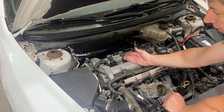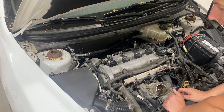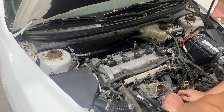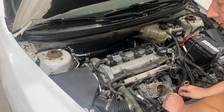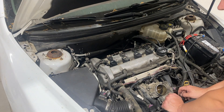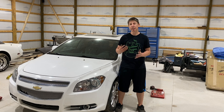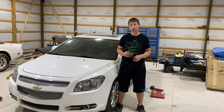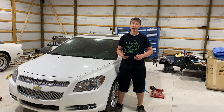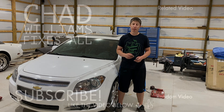After you're done, go ahead and clear the codes on the computer using your scan tool or by resetting the battery. After that, restart the vehicle and see if the misfire or codes go away. So that's going to be it for this video. If this video helped you, please click the like button, subscribe to my channel, and check out the Amazon links in the description below. I've got quite a few videos out there for this Malibu. Until next time, thanks for watching and see you later.